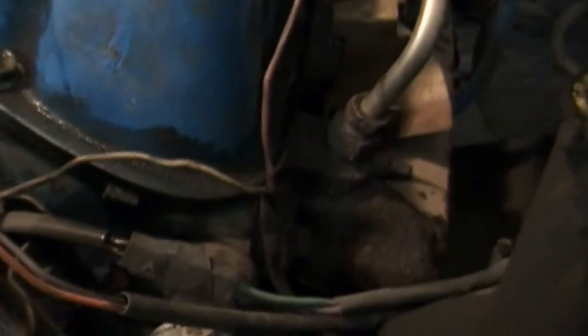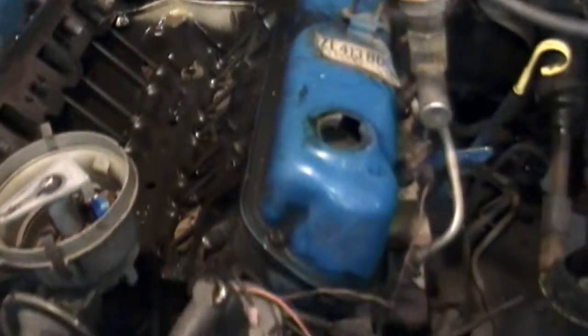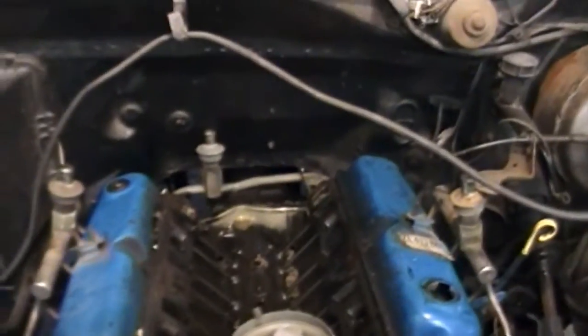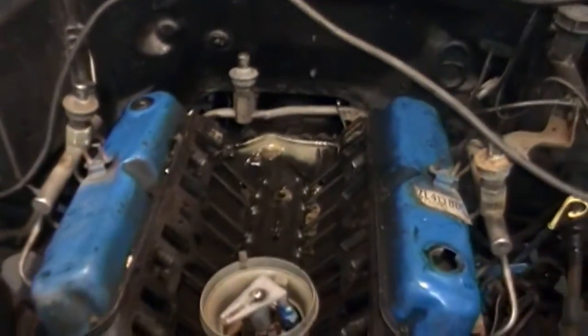Not only that, you got these emissions lines, a stainless steel manifold right here, with all these rusted to hell fittings and rusted to hell bolts. There's plenty of room in here, and it might be a little bit heavy, but I'm just gonna pull the two bolts off of the downpipe there, because they're still in good shape. Geez, there's almost no rust on them for some reason. So I'll just pull them off as a unit. But at this point, it's time to pull the rocker covers and start pulling the rocker arms off, line them all up so I don't get anything mixed up.